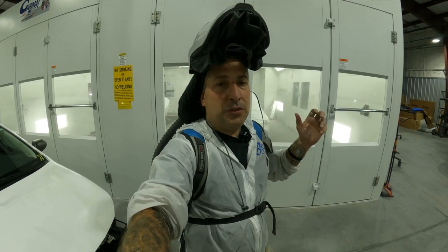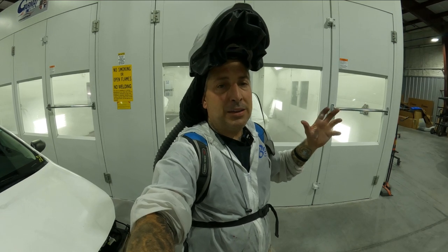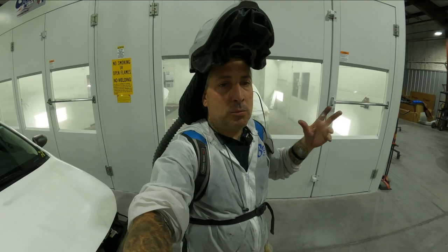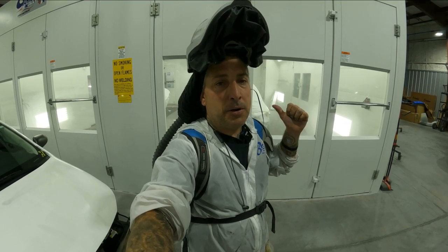You guys let me know if you're doing it this way or are you putting down the etch and sanding down the primer? Because to me, that's a lot more work, and you don't get any more money to do that. And this is a better product to use, the epoxy.